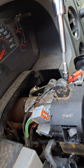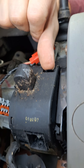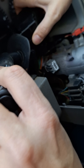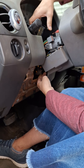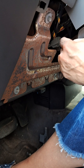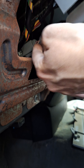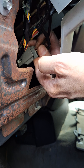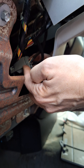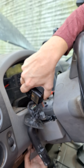We've already removed the 5.5 millimeter bolt that goes right here. There's a pin right here — we're going to push that pin in and lift the unit out. There's one more plug on the bottom that we need to disconnect. Once you've lifted it up, there's a cord on the back — trace that down with your fingers to find where it goes. There is a release button just like the top ones, right here. Feel for it because you can't see it — release and pull, push up the bottom, then it pulls out, freeing the unit.